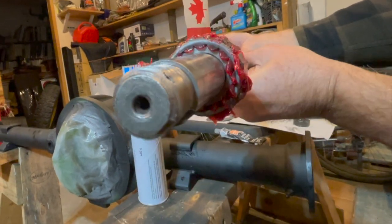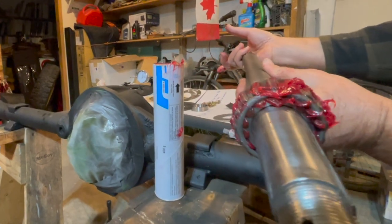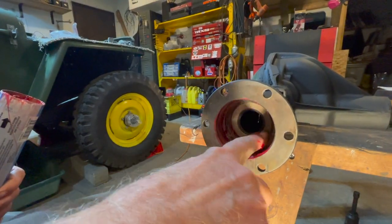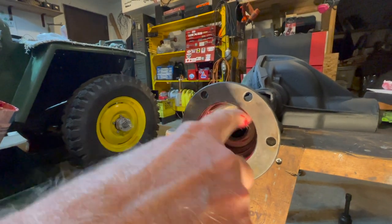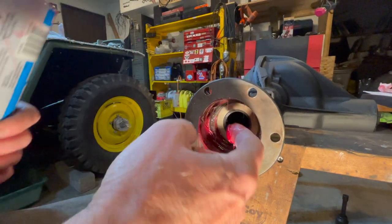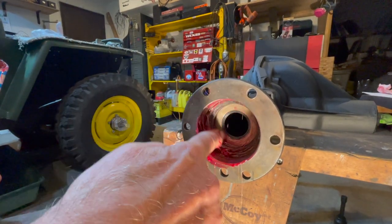That's the only way to do it when you have your bearing ready pre-installed and pushed on. The next step is to apply wheel bearing grease to the inside of your axle housing and put a little bit on the oil seal at the back as well, just so it rides on the axle.